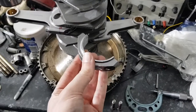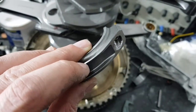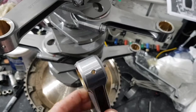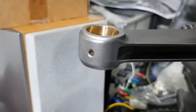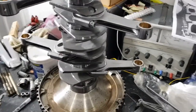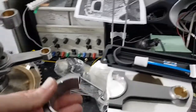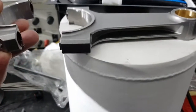The con rods have been cleaned up. You can see on one side where it's been machined — that's where the balancing has been done on the big ends. On the little ends you can see material has been taken off around the circumference, a very neat job. There's one rod that hasn't been touched — that must have been the lightest one. All the others have had material removed to match the weights, so all little ends are the same and all big ends are the same. The two halves bolt together with writing on one side that matches up.